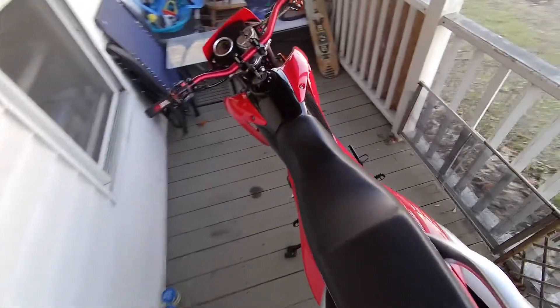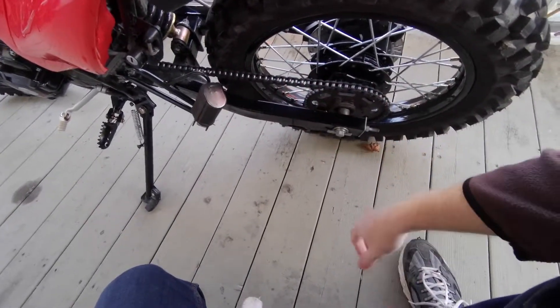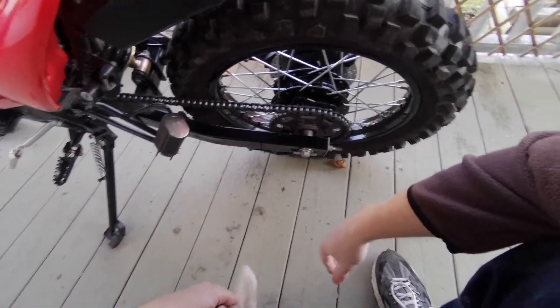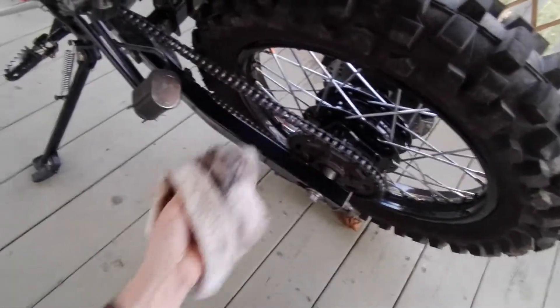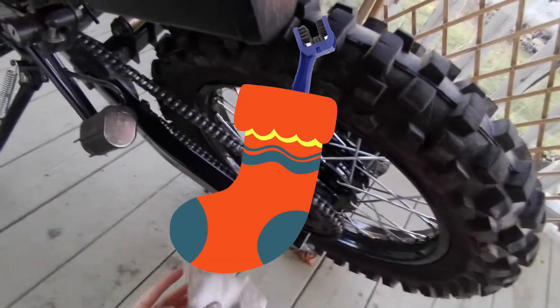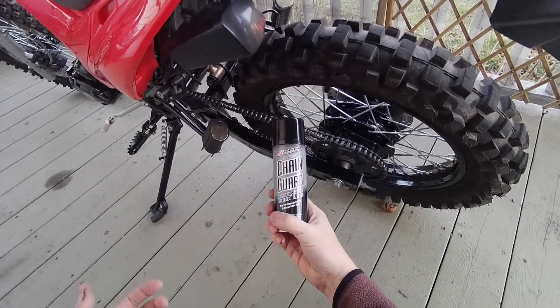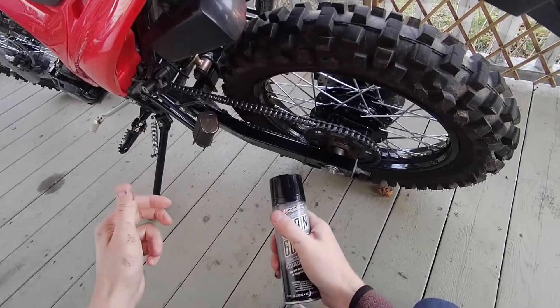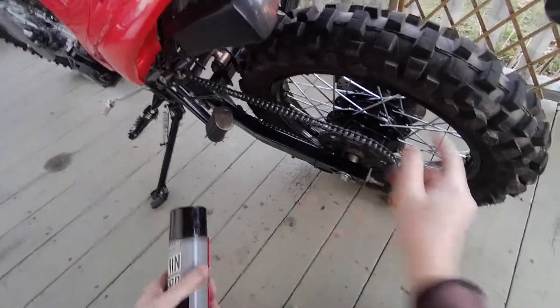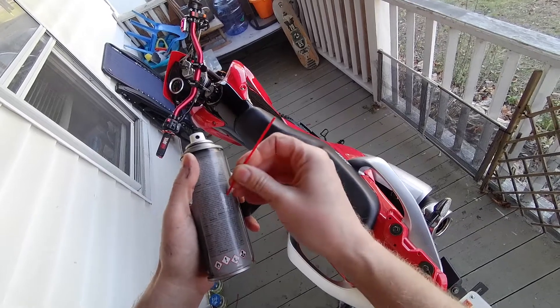Alright, I shut the fuel off. While I'm waiting for the engine to cool I'm going to clean and lube the chain — you don't want all this crap sitting on here for the winter causing corrosion. Kerosene works really well for cleaning the chain, or any specialized chain cleaner is fine. Hopefully Santa brings me a chain brush. Once you've got it all cleaned up, hit it with whatever chain lube you like. I'll get the bike up so I can spin the tire and spray this down.